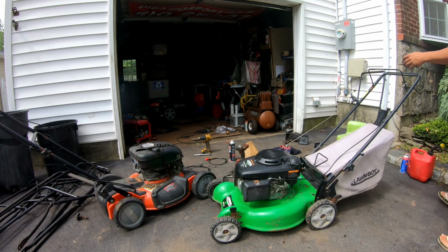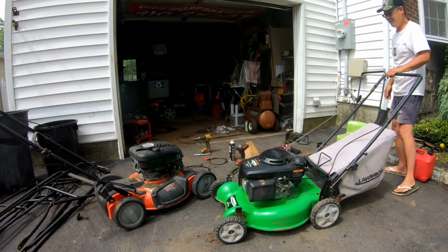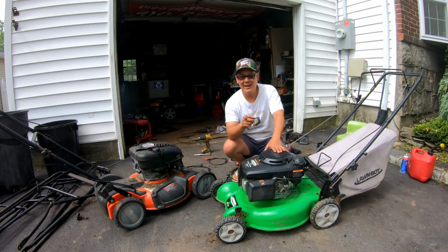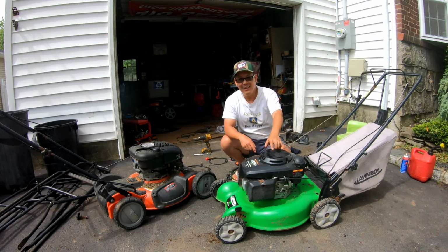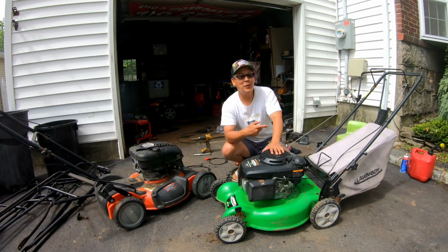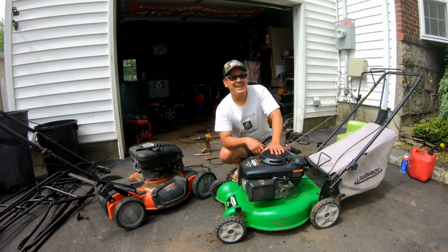All right, a quick spit shine. Fabricated a cover for the air filter base, put a handle on the pull rope, got a bail handle stopper, a new cable, cleaned the carburetor, put gas in it. Now it's a pretty good running Lawnboy push mower with a bagger. I'll list it for $145. Take as low as $80.